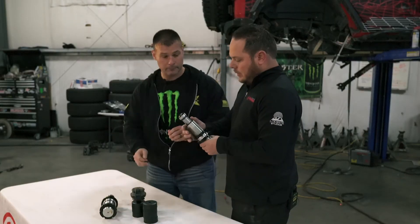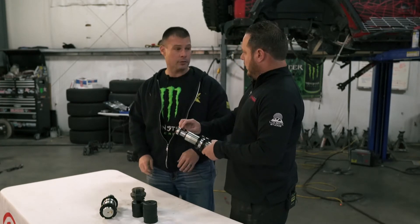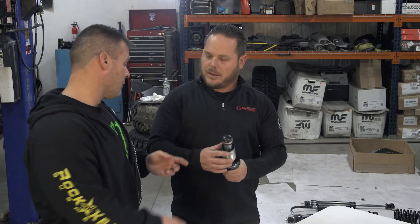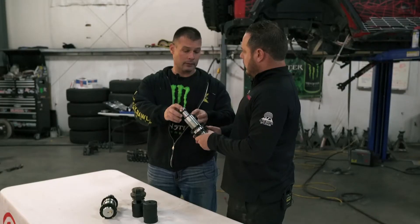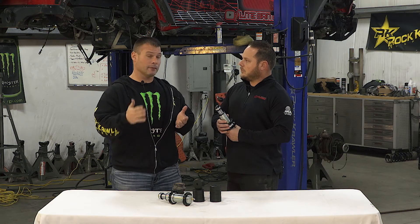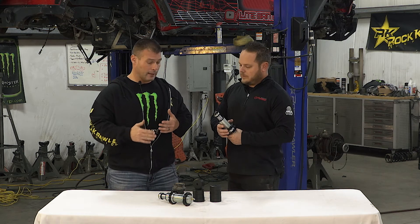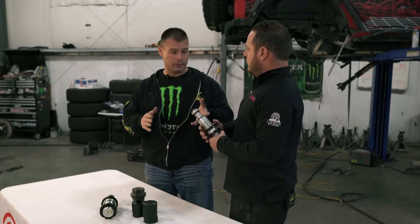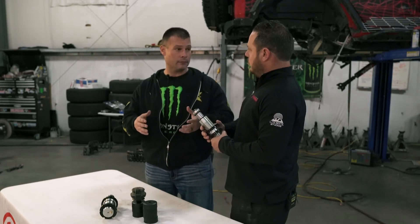The one and a half refers to the stroke. If you needed more — say two or two and a half inches — you can take it apart. There are typically spacers underneath the valve stacks that allow it to stretch out further. For on-road usage, you're typically going to see anywhere from a minimum of four and a half inches of compression out of a shock to five and a half or six inches — six is a very comfortable number. Most setups are in the two-to-three or three-to-four inch range for the bump stop stroke. We have Radflow setting these up for us specifically so they don't engage when on the road all the time.